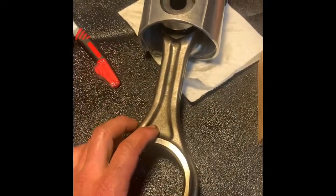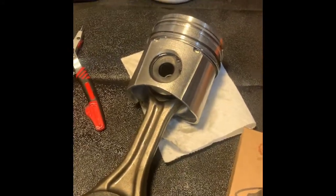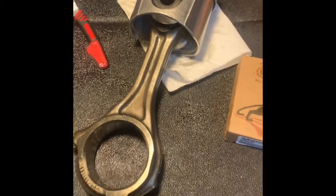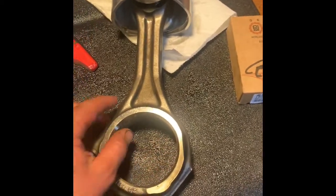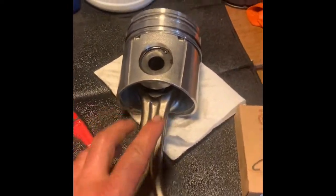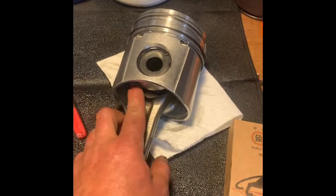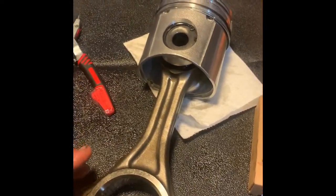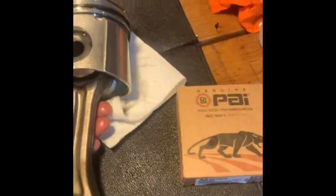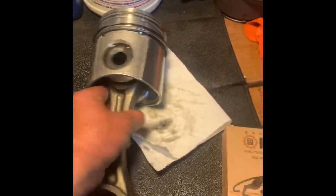Here's our new piston mounted on the rod assembly from my 2004-and-a-half Cummins 5.9. We're in the middle of an in-frame overhaul due to four broken compression rings in multiple pieces across four cylinders. The block looks good. I cleaned everything with parts cleaner and lubricated with Lucas, which I like as an assembly lube because it sticks to everything - the piston ring grooves, rod end bores, wrist pin. There seems to be confusion about mounting pistons backwards: the long side of the piston faces toward the driver's side of the truck.